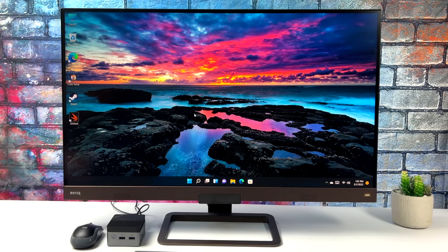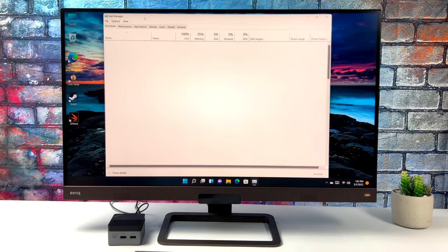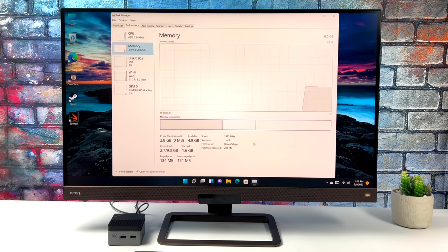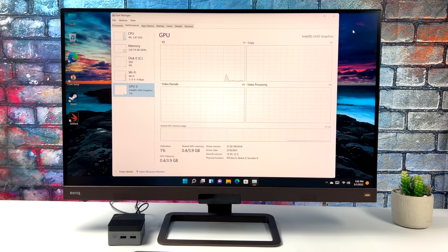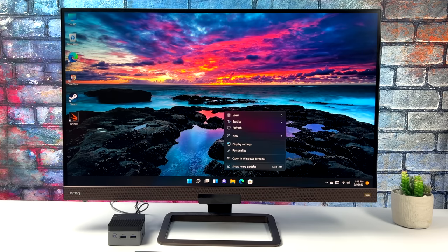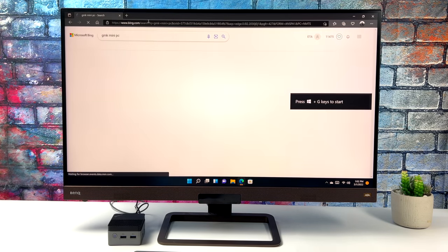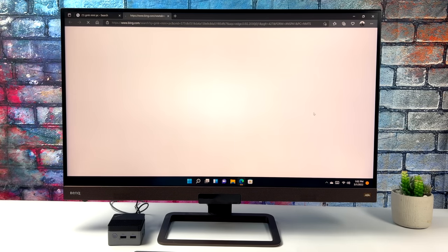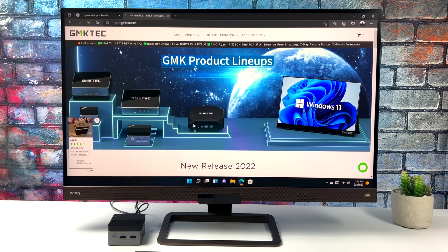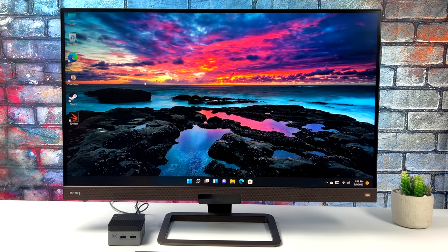Everything is set up and this thing is absolutely tiny — not much bigger than my mouse. I have to say it's way snappier than I thought it would be. The CPU isn't top-of-the-line, but for web browsing, email, and video playback it works out just fine. The RAM is running at 2,933MHz in dual channel — versus 2,400MHz on older Gemini Lake — which helps GPU performance. The TDP out of the box is set at 13 watts and it doesn't pull more than 18 from the wall with everything running at full load.